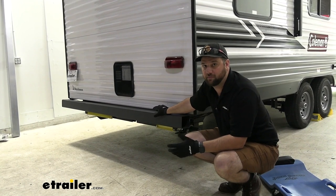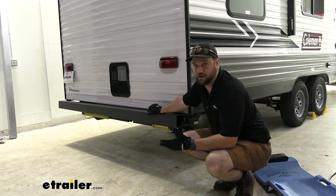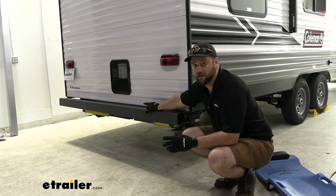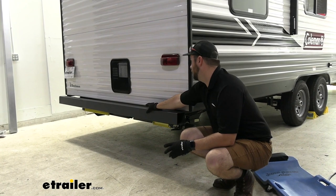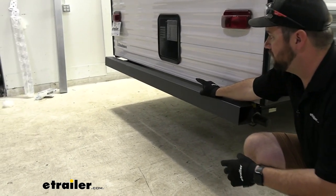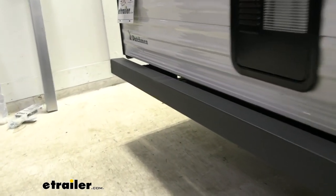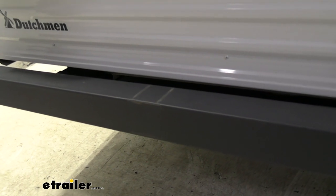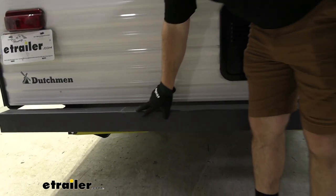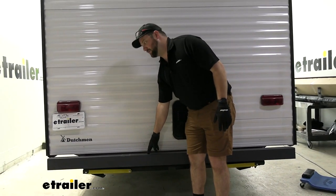There are a couple of different issues with this factory bumper. The tubing is too thin to be weight-bearing, and going down the road the actual tube itself will twist. Ours has started to twist a little bit, and it looks like there used to be a hitch receiver on here, or at least a spare tire mounted down towards the end. Just that spare tire bouncing on the back — or a generator carrier — obviously had something here and it added a twisting action to the top of this bumper.